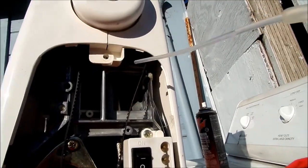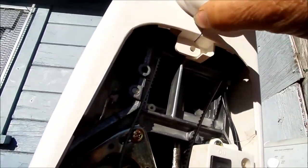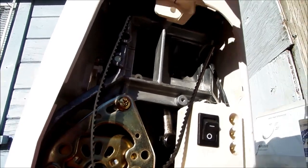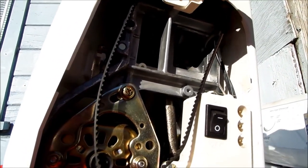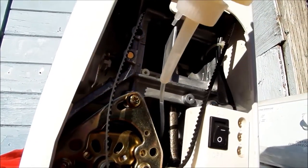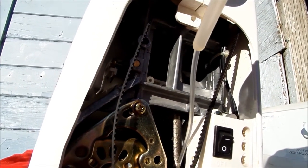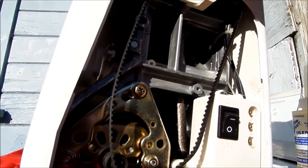This part here — any of the moving parts that you can see when you move this — be careful not to get any oil on your belt. Any of those moving parts, you just want to stick a drop of oil on, and the machine will work a lot better. Sometimes you don't have oil on these and it dries up — you're just going to get real stiff, and your motor may even shut off.